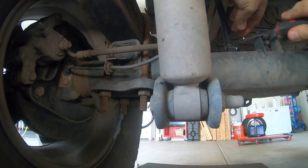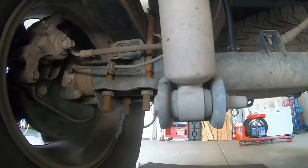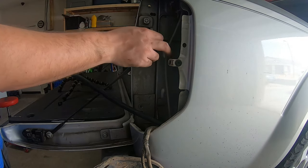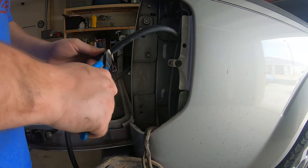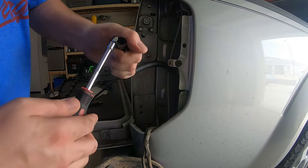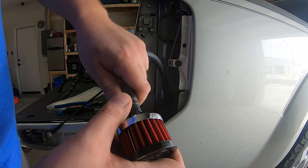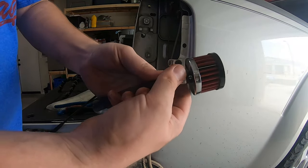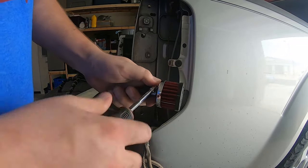We're going to connect this with the hose barb — put it in a position you can get to now and again later. There's no pressure on this hose, so you don't have to go all hulk style and crazy cinch the heck out of it. Just tight enough that it's not going to come off. Now we pull our extra slack up through the taillight housing. Cut the hose a little bit long, slide the filter on, move your clamp up to wherever it feels good, and tighten it — again, just till it's tight, don't overthink it.